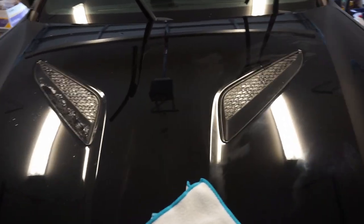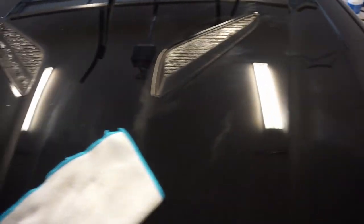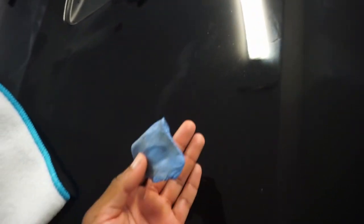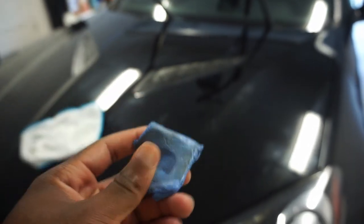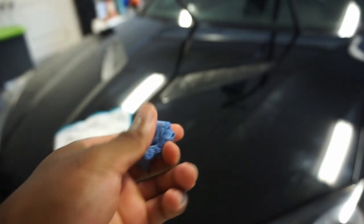One thing you can notice right off the bat is this side has a little haze — I'll get a different microfiber towel and buff that out after. As you can see, there is a difference, though the camera may not fully capture it. This untreated side still has impurities — you can actually hear the roughness when the clay bar passes over it. The treated side is smooth and you can't feel anything in the paint, which helps with water beading. If your clay bar gets dirty, just knead it a little more, and when you need to, grab a fresh piece.